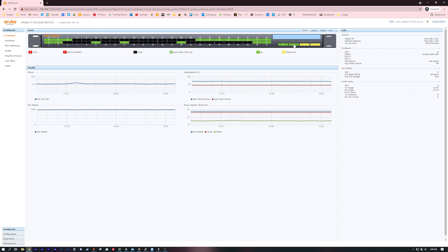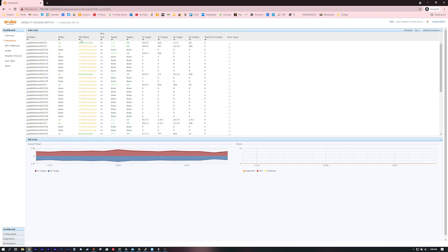We have a G3 Flex camera, a TV and a soundbar — things that aren't really using a lot of throughput. I can see the status of my ports, my connection to my server, and my connection to my desktop right here. Two of the SFP+ ports are stacking ports, so these cannot be used to connect a desktop or server. But I have a range of ports that are all PoE devices — a bunch of different access points, some cameras, a few flex switches. This thing has 13 devices pulling PoE from it right now and it's doing pretty good — keeping up and providing enough power to keep my flex switches powered up. One flex switch has two access points connected to it as a test, and it's handling it very well.